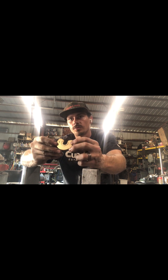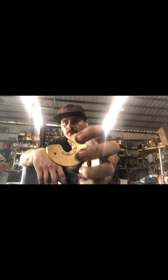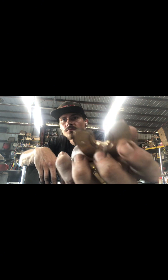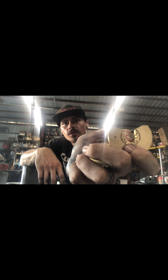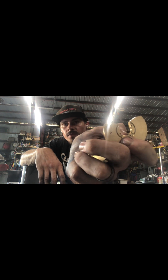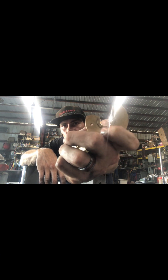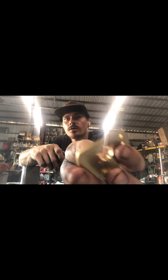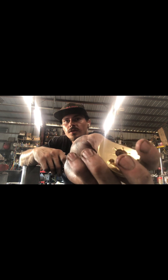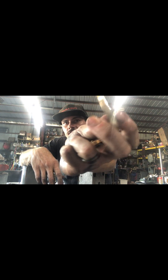These thrust surfaces — between each one of those oil galleys — are tapered. As you can see on this one where my finger is, it's been hit. You knock these down enough and they no longer work. What these do is raise the oil pressure on the surface to a much higher pressure than your oil pump's pressure. This one has more thrust pads. You cannot fill in and start grooving between thrust pads — they're tapered. If you groove between the pads, you do the same thing as surging this thing and tearing it up.